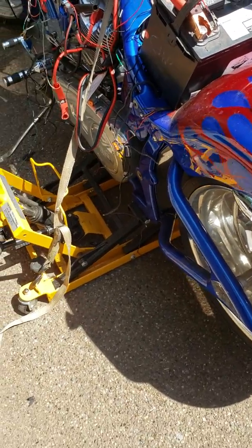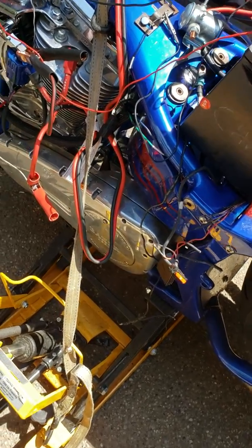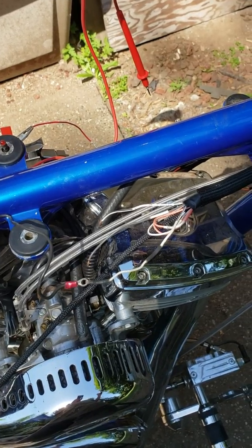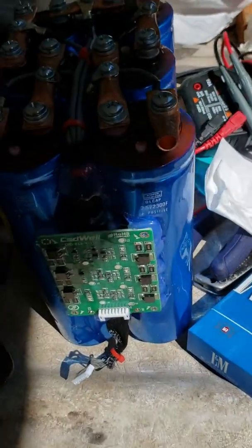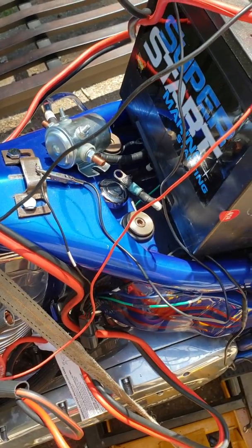This is a video log of locating your parasitic ground. This bike has been eating a lot of batteries, but on top of that I decided to redo the entire wiring system and isolate the lights — brake lights, turn signals — all of those will be run on a separate battery. Then my bike will be started by a hybrid supercapacitor battery bank.